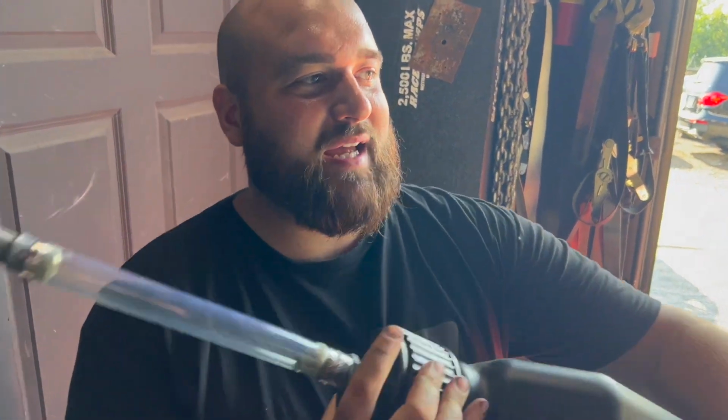If we get ProFlex on that car, sure, the car could be tuned 93, the car could be tuned E60, drain everything out, switch maps. But if we can create a true sensor with a ProFlex wired into the ECU, where you could just put 85 in it, it flexes, changes the map on the fly, and calculates for it and changes the ignition and the boost and the tables. Game changer. We'll see in a couple weeks if Turbo Hand shows up with the car. It might not be possible right now, but it would be something I would love to do.